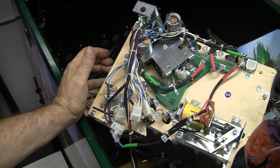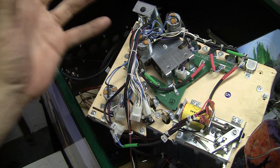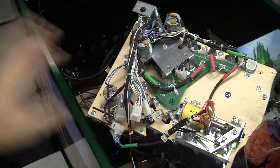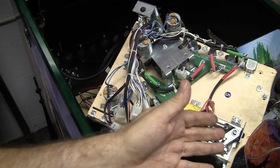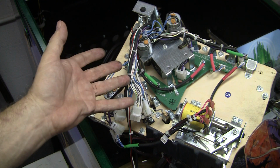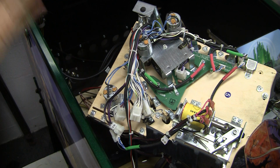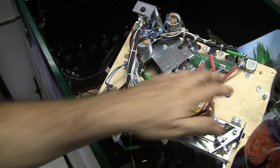So I would consider this a hardware design issue that is significantly exacerbated by poor software design. And I'm talking to you, Keith. We've asked over and over, and you've said flat out you're not going to offer a feature to disable these upper playfield flippers. In addition to the wear and tear and having to prematurely service these things, we have now discovered another problem: because of not disabling this, it's triggering these very delicate cherry switches in the castle doors, and it's causing the whole game to malfunction and not play properly and switch into a different mode when the ball is not even up here.